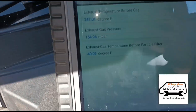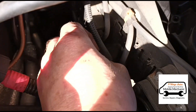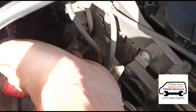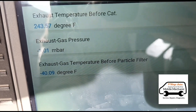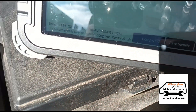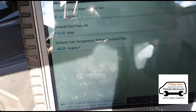I've got the engine running — exhaust gas pressure is on 160. I'm going to come down here, unplug that sensor, and you can see the pressure drops off. Now I'll plug it back in.